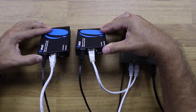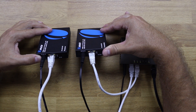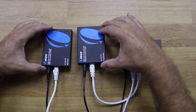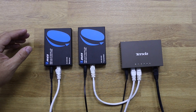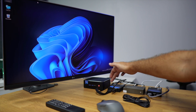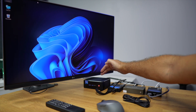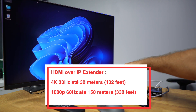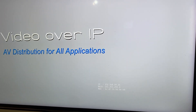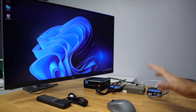The HDMI over IP encoder or transmitter will connect to the PC, receive the HDMI signal from the PC, and connect via USB to the PC so we can control it. It connects to our network switch and sends all that signal. On any other point of our network we place the HDMI over IP decoder or receiver, which connects HDMI to any TV or projector, connects to the switch, and connects keyboard and mouse to control the computer at a distance. This allows transmission up to 4K 30Hz at up to 40 meters, or 1080p 60Hz at up to 150 meters, without any latency.